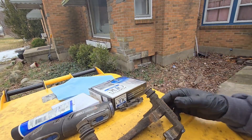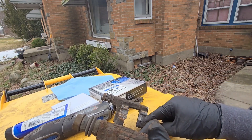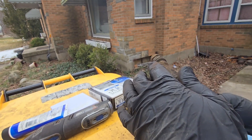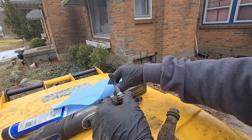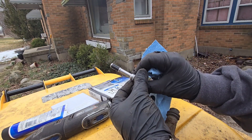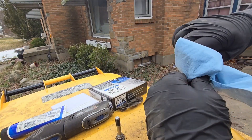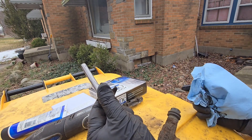Those are clean - I cleaned the mating surfaces where the hardware is going to sit, also on top, on both sides, inner and outer channels on both sides. Now we're going to work on the pins - take these pins out and clean the old grease off. They're nice and shiny, they look good, no rust buildup - that's a plus. Same on this one, clean it up, nice and clean, no problems.